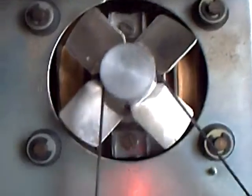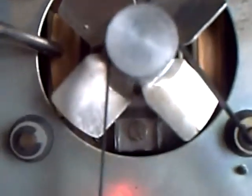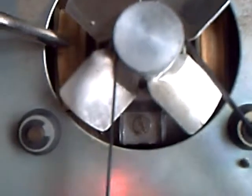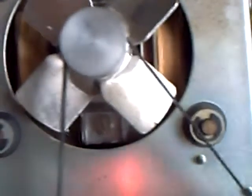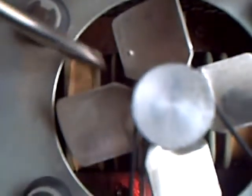You can see it down there — part of it — the edge of the circuit board. So where is the transformer? Well, it's on the motor. You can see there the buff-coloured part either side — those are the running windings. Now tucked inside there is a smaller winding, and it's that that provides power for the amp on this.